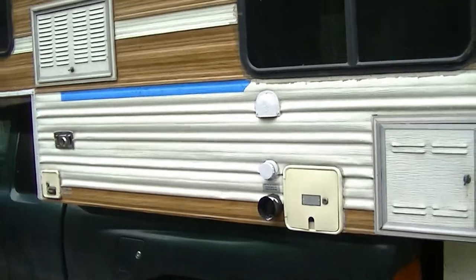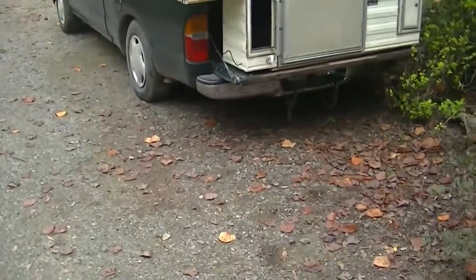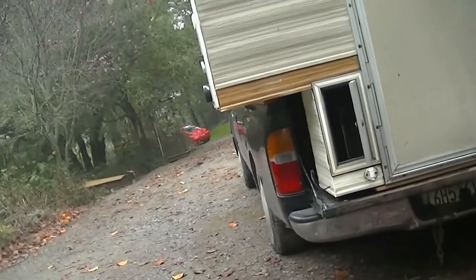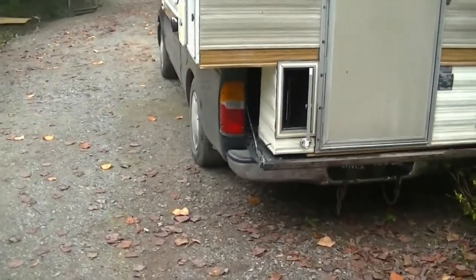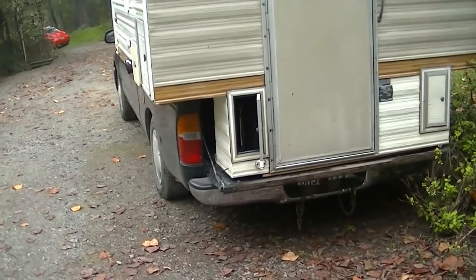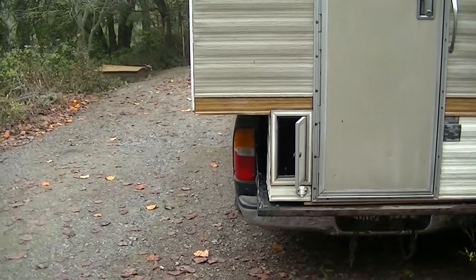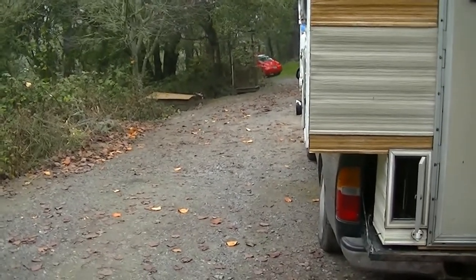So if you're coming to buy a camper and you haven't got any tie downs to your bed or frame, and you're not sure about the distance — in this case I've got about a quarter inch thick piece of rubber mat on the bottom of the bed, because if water accumulated in there I didn't want the bottom of the camper wet. This camper did not have a plywood bottom, just framing, so I got a piece of half inch marine ply and put it under there. Those two things raise it up about three quarters of an inch.